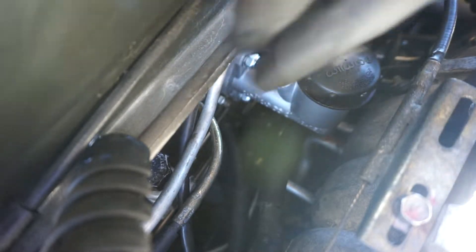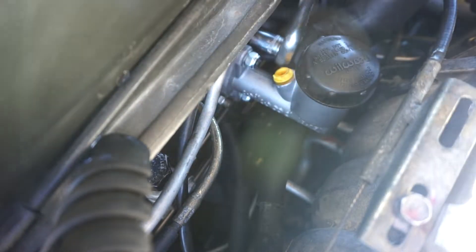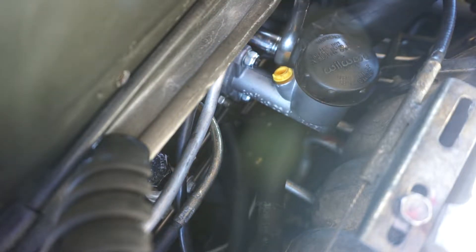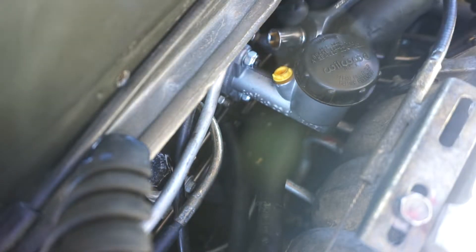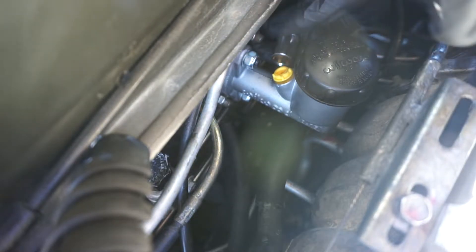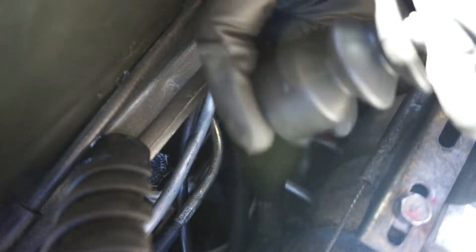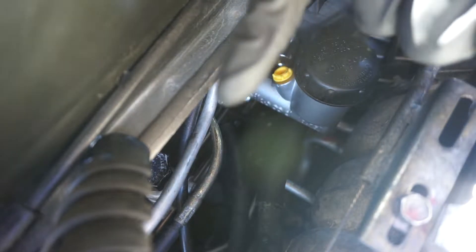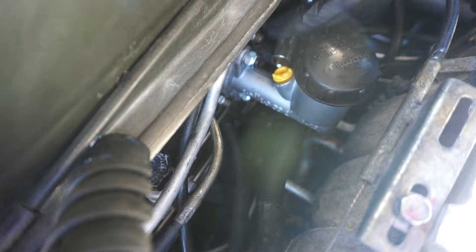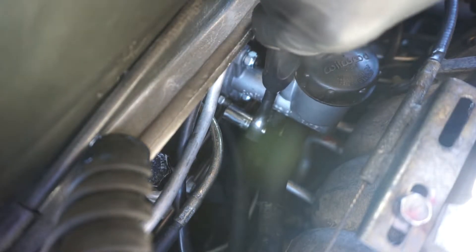You guys are going to have to cut into the clutch master. I also couldn't use the hole I drilled out because this car was automatic originally. I think I drilled out one and three-eighths — should have been one and a half. The Wilwood cover would have worked well with that, but I have a smaller hole so I just use the OEM cover, which is fine with me. Just keep in mind that this might be a little tight inside the firewall hole, and you can use the original one or die grind it out and make it bigger.